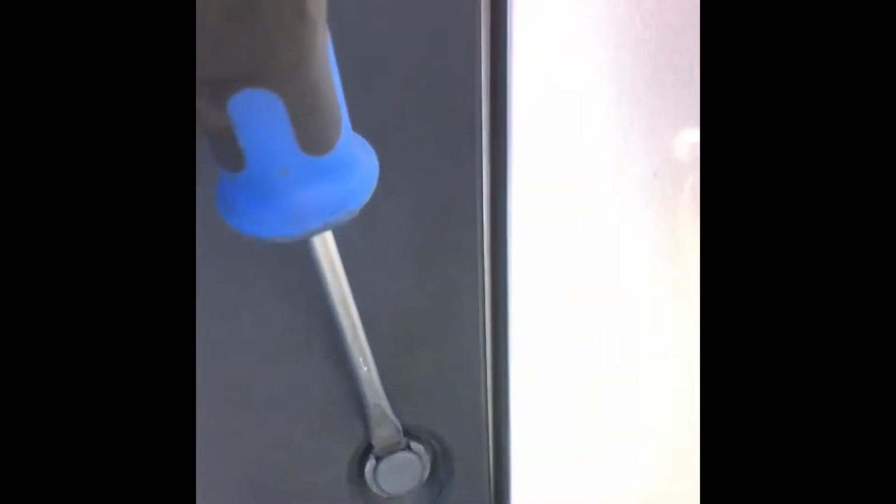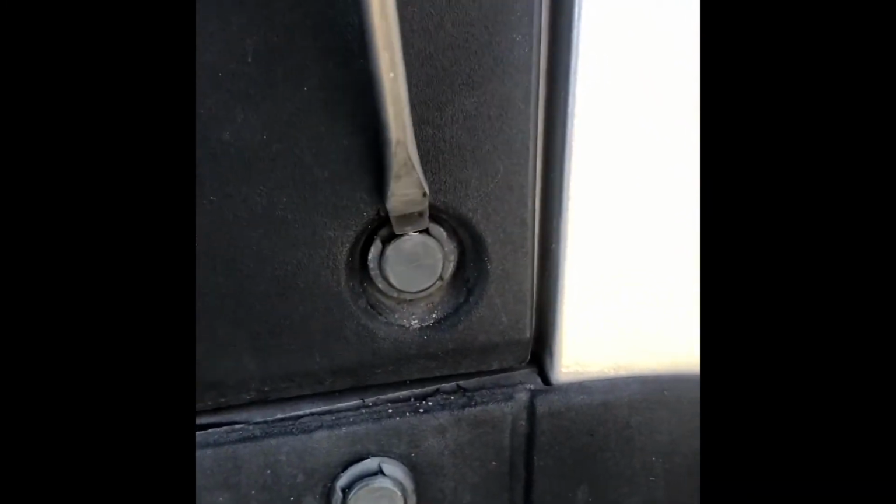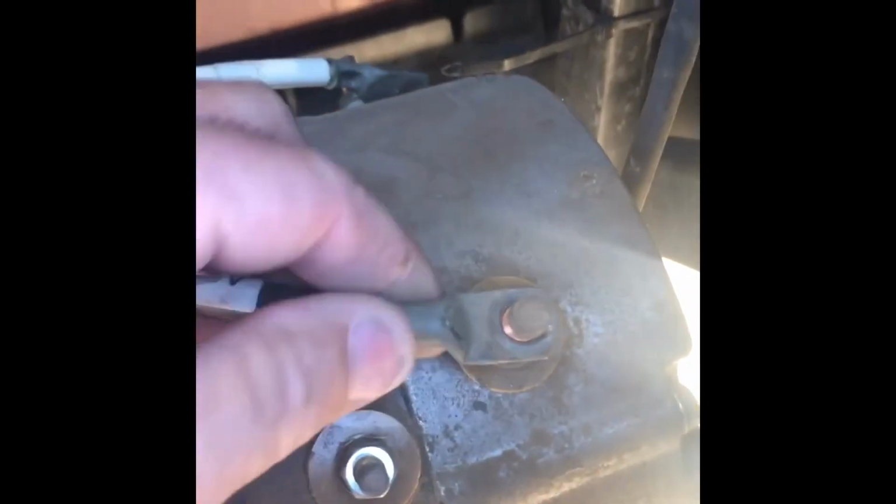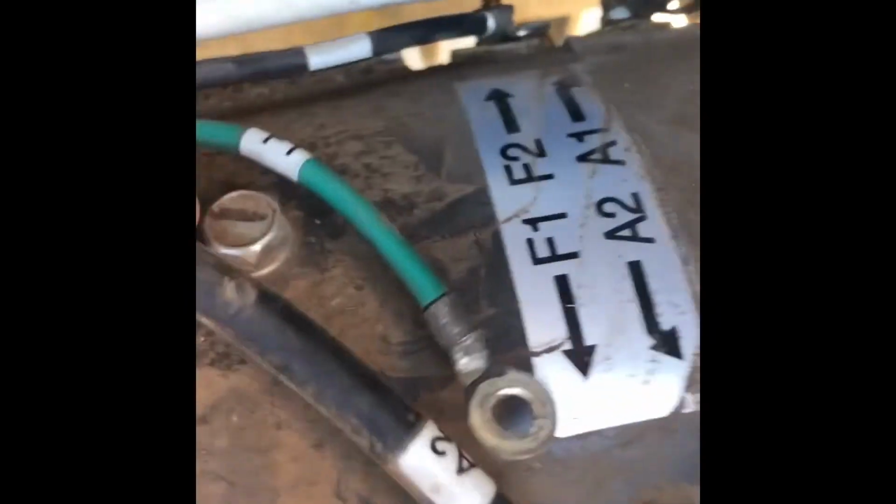First thing is to remove these clips so you can get to the wiring of the electric motor. So next thing is 10mm there, 13mm there. Remove all those wires. Don't forget this guy. That's the speed sensor. Unplug that. Once you've undone them, just bear in mind, they're labelled. They've all got labels on them. When they're going back on, don't mess it up.